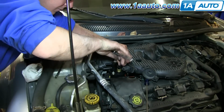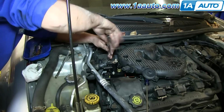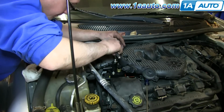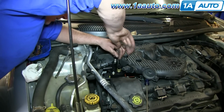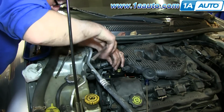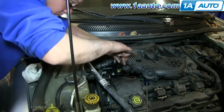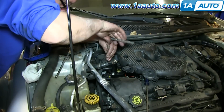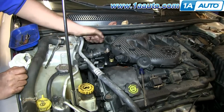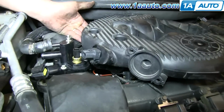And we'll tighten those 8mm bolts up, and they're usually in there about 100 inch-pounds, which is 6 to 8 foot-pounds. You do just want to seat them all first, get them all seated, and then tighten them up evenly using kind of a crossing pattern. Now you can remove whatever you have holding the manifold up and make sure it seats down into place correctly.